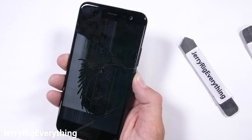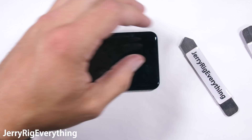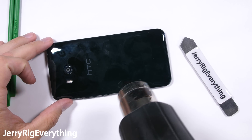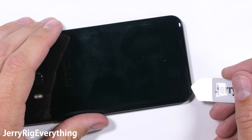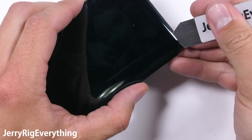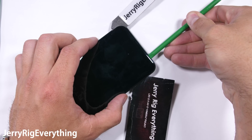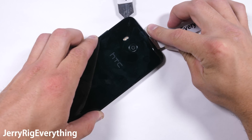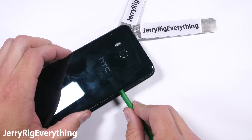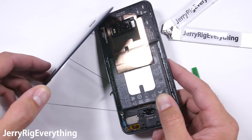Normally I would turn my phone off first, but I can't. Long pressing the home button doesn't work at this point either. Since the back glass panel is not embedded into the frame like on a Samsung, it is a relatively simple process to remove as long as you don't slice too far into the device with your tools. After the glass is just barely too hot to touch comfortably, I'll slip my thin metal pry tool between the aluminum and the glass and work my way around the edges. After the glass is up, I'll stick my green pry tool under the panel to keep it from re-adhering back to the frame and continue the cycle of heating the phone and slicing through the black adhesive. The black stuff is what helps keep your phone water resistant, so definitely don't trust your phone around water anymore after you've done any repairs.